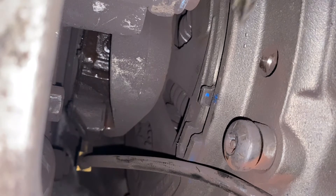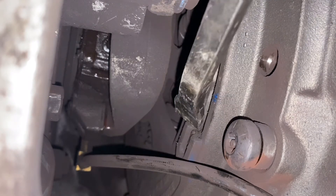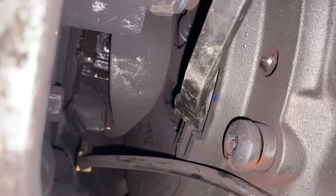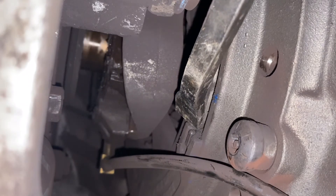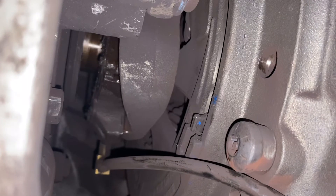Get my partner to push the clutch. So you push that indicator tab all the way up to the top there. Now that'll put it into the position where it's like new — clutch back out, and as he pushes it in and out you'll see it self-adjusts up.